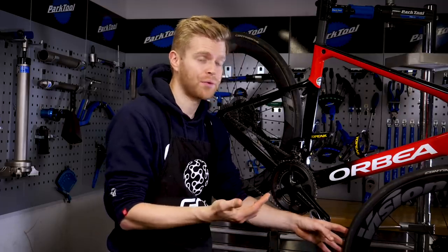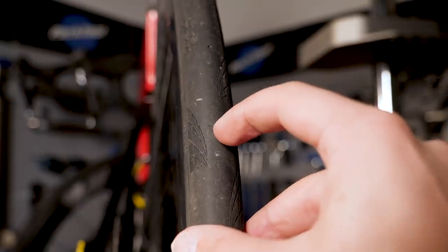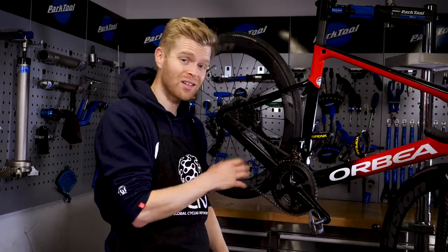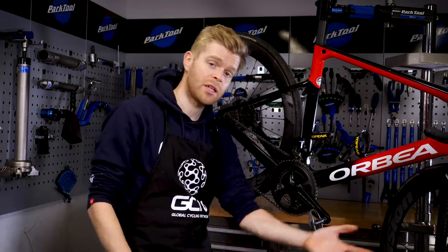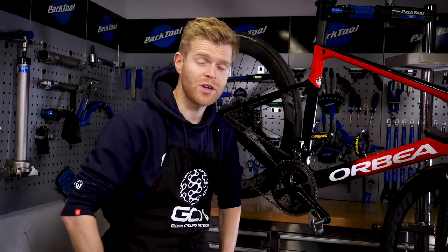It's a good idea before or after a ride to check your tires for any little flints or bits of glass that have got stuck in them, then get some tweezers or something fine and carefully pry them out, because over time they can work their way in deeper and cause a puncture when you don't expect it. Also look at the wear on your tires — tires like these Continentals actually have wear holes that can tell you how far your tire has worn. On road bikes, the rear tire always wears out quicker than the front. An excellent hack to save money is to rotate your tires — after your back one has worn out more, simply swap it for your front one and you'll get more mileage out of them before you have to replace both.